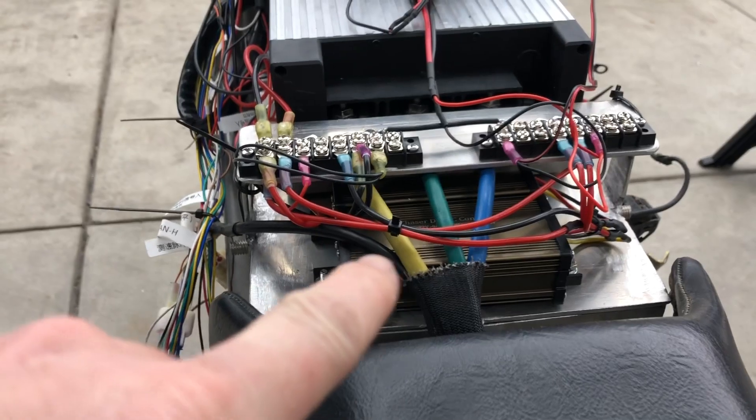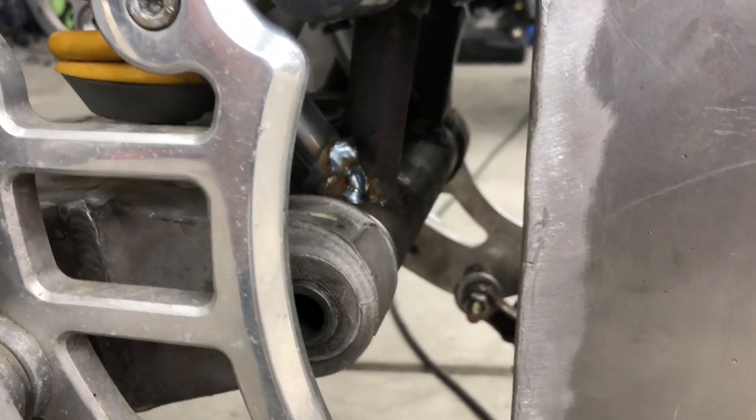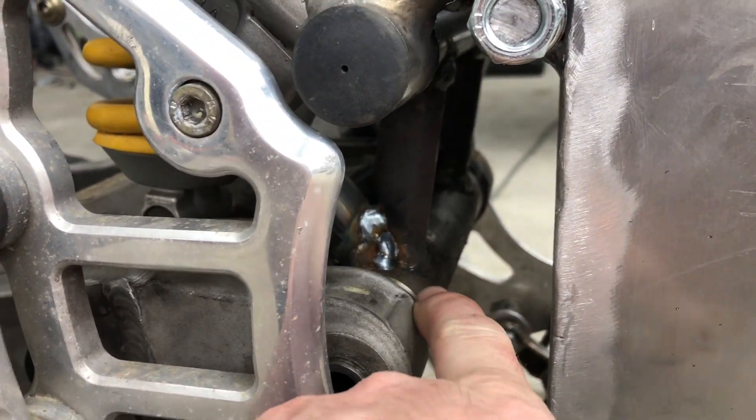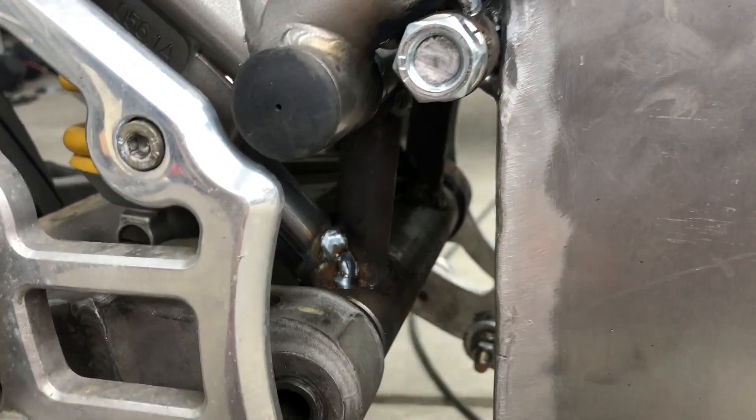I'll shorten the phase cables once everything is in the correct location — just snip them, put new ring terminals at the right distance, and pull all the slack forward. For the custom swing arm attachment, I had a tube bored out to 26 millimeters, and it has the stock Ducati bearings in it. If you want to replace your swing arm bearings on a Ducati Monster, just buy Ducati Monster 750 bearings — that'll be a drop-in replacement. It has a vertical attachment up to what was formerly another rod running through the back of the crankcase, now replaced with a welded-on tube with a threaded rod inserted through for additional strength, plus an angled tube running up to the top.